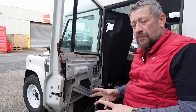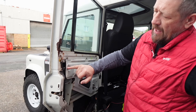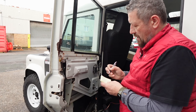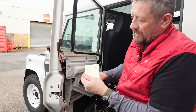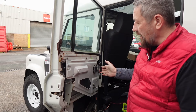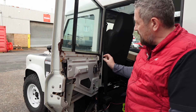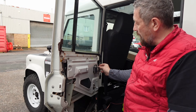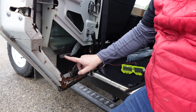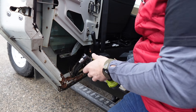I'm going to try and make swift work of this. The first thing I'm going to do is mark off where my L-shaped brackets are that control the arms for all the latches and mechanisms. That just makes sure we can put everything back together again. We have to remove our interior handle, which is connected by this rod to our mechanism. We've got to release our push-down lock, which is just a little clip, and then we should be able to take our regulator off. The window is held onto the regulator channel just with these two 8mm bolts that go through to these plastic fixings, so we want to undo those.